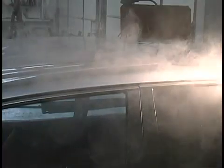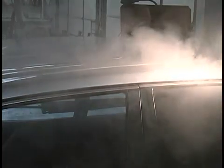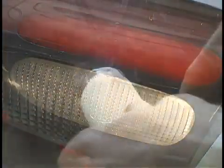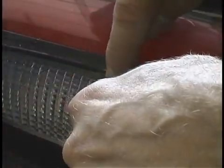Move the smoke around the area where a leak is suspected. Hold the smoke a few inches from the test area and search for the disturbance caused by the leak. Now mark the area and make the repair. This test must be conducted in still air. You may want to close the doors in the shop for this one. Repairing leaky headlamp or tail lamp housings is a snap. Insert the Smoke Pro nozzle into the bulb hole and use a little silicone to make the repair.